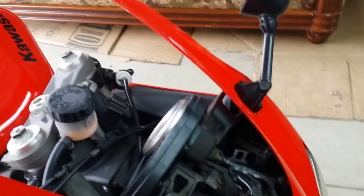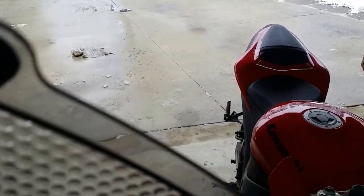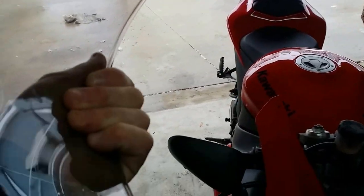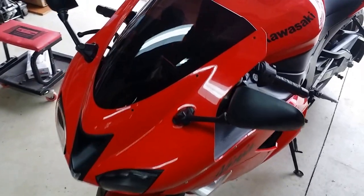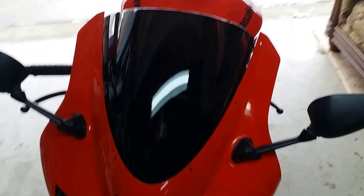After that it removes and you have to transfer all the grommets back to your new windshield. Before you take them off, put the new windshield in and make sure it fits — that all the holes match. Mine fits and the holes line up, so I'll start doing that.